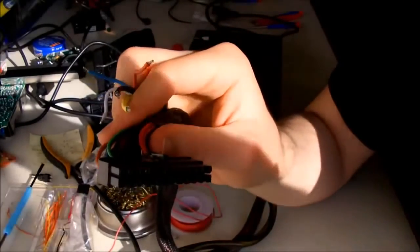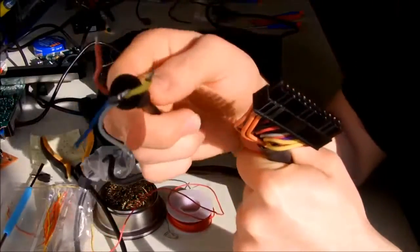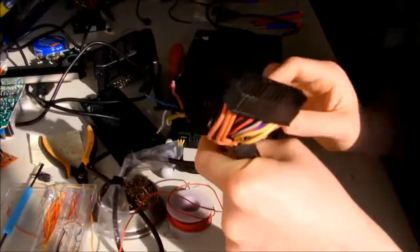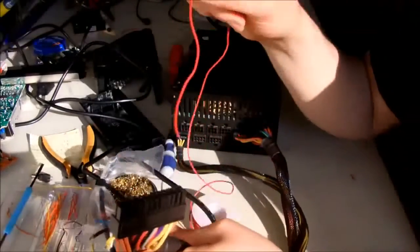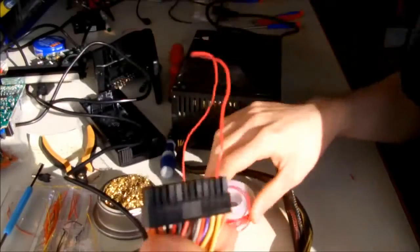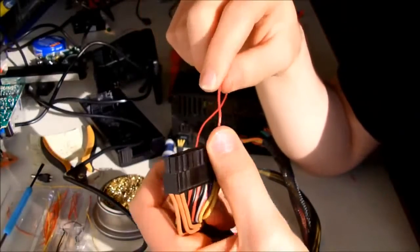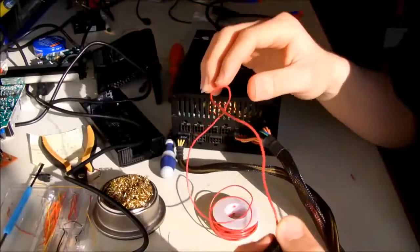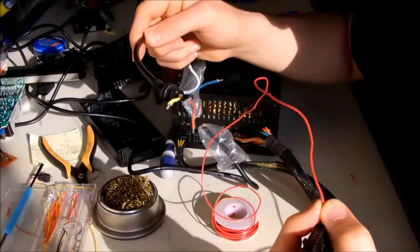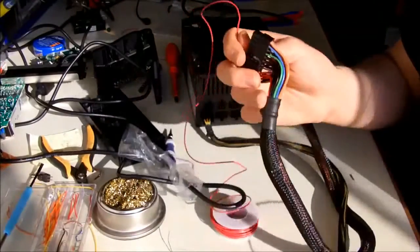So right now I'm going to make a connection between these things, but I don't want to destroy the connector from here, because these cables have a thick ending and they don't just simply plug in here. What I'm going to do is use some extra wires, so I can put some wires, for example, for the 12 volt. I just simply put this into the yellow one. Don't mind the color of the cable I'm going to use, because I have only this cable at the moment. And the other side I will just solder to the Xbox connector. This should be quite easy. So I'm going to turn on my soldering iron again and start doing this.